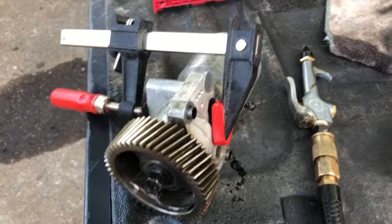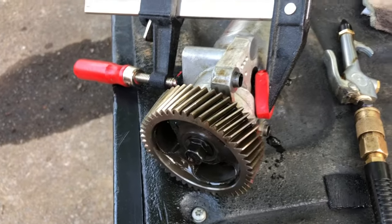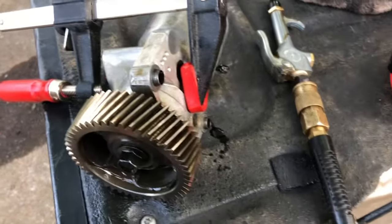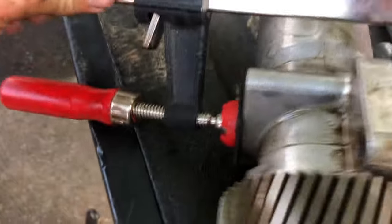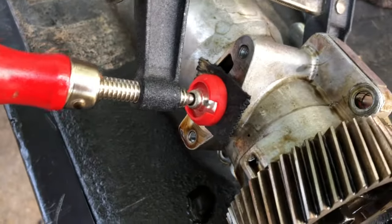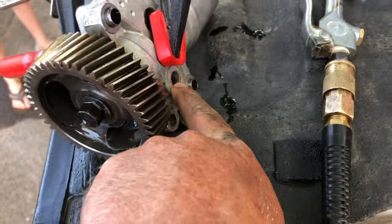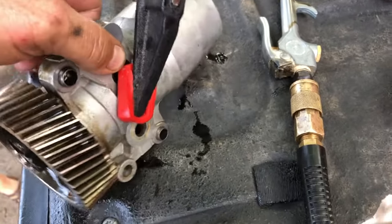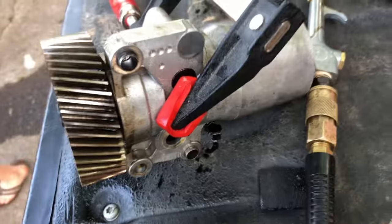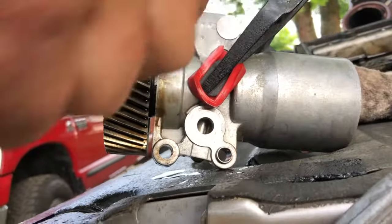I'm trying to figure out if I had a bad high pressure oil pump — I can't find a video anywhere online that tells how to test it. This is the bottom of the pump where the oil pumps up into it; here's the pressure side. I took a piece of an old tire and one of my carpenter clamps, sandwiched it on there. Because the hole in the bottom is offset, I was able to center the clamp right on the pump. I have a bad high pressure oil pump and I'll show you how I know that. Jack, you might have to get a different angle — watch right in here where the drive shaft comes out of this pump and you'll see it all start blowing out.